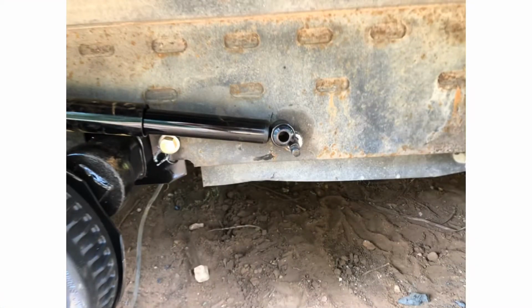Okay, just got off the phone with him. He was a little bit standoffish, but he basically said that, oh, of course you got to re-drill the new bolt holes. I tell everybody that. And this has never happened to me before. This is the 3rd trailer I've done. Never had to re-drill bolt holes, more than just maybe something you could do with a file. And as far as the length of the shocks are concerned, I think it has to do with the fact that the bolt holes don't line up, so it moves the axle farther back just a little bit. But he said just to preload it and put the shock in there, so that's what we're going to do.